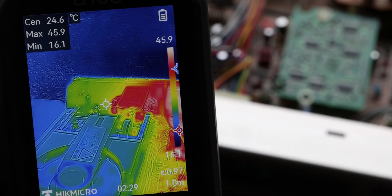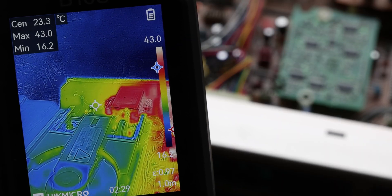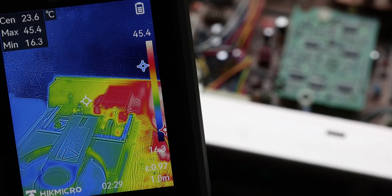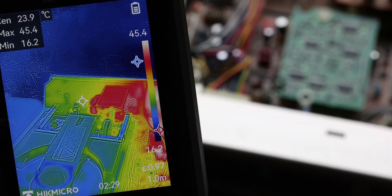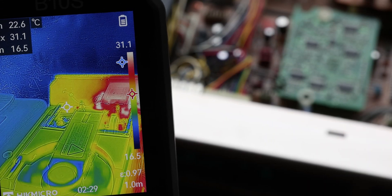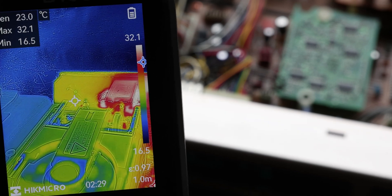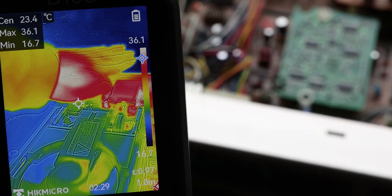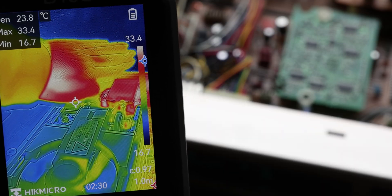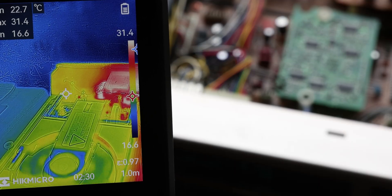If we step back a little, you can see the disk spinning — this is a live image with a very fast refresh rate. The hottest area seems to be around the transformer area. The transformer is the hottest part here, running about 31 degrees Celsius — fairly normal. If I put my hand here, you can see my hand becomes the hottest part, so we know the transformer at 31 degrees is running cooler than your hand. If you put your hand on it, you're actually going to feel it as cooler.